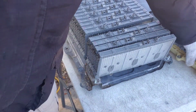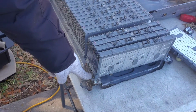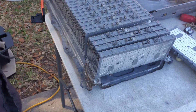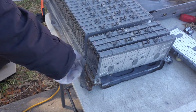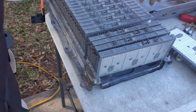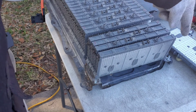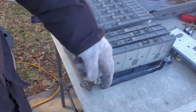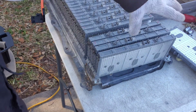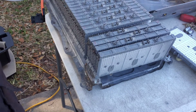The other option you could do, of course, you don't know which side, these are only bolted, they're alternating bolts, so you don't really know unless you do a quick feel underneath which side the bolt is. But I suppose you could probably just prop this up and use a ratchet and ratchet all of these loose. If you want to, just put a couple blocks of wood under here to raise it up, loosen these, take this bolt out, whichever side it's on, and lift it straight out.